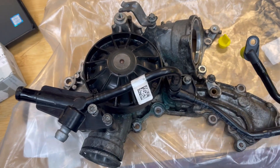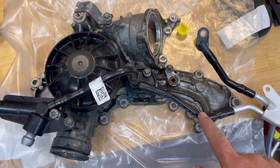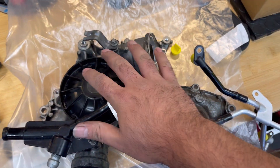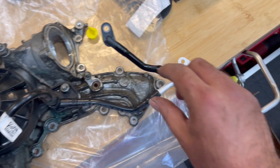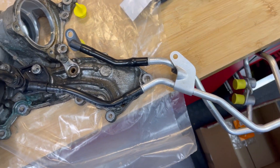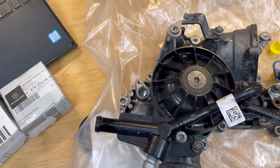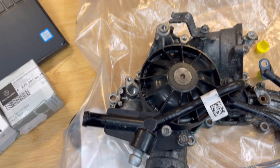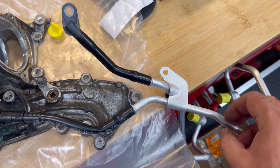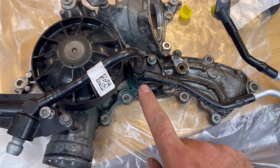A point to cover: a lot of people ask why are these made the way they are. I'm not covering the right-side turbo here — this assembly goes on the front of the engine with lines going to the turbo, sandwiched and going into the turbo right where my hand is. You never see those leak because they're rubber-metal pipes crimped into very thick rubber hoses, so that side is never problematic. This side is.